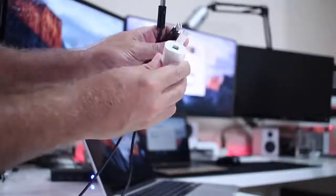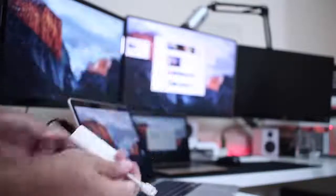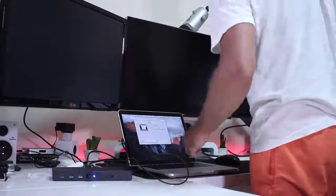I also tested with my MacBook Pro early 2015, and with a Thunderbolt 2 to Thunderbolt 3 adapter it did not work. This means it works over the USB port instead of Thunderbolt. If you have one of the newest MacBook Pros — 13-inch or 15-inch with Thunderbolt 3 — the USB bus runs on the same port, so you will be fine.